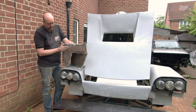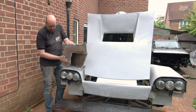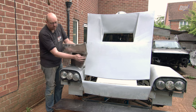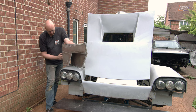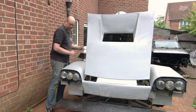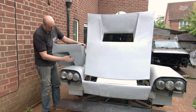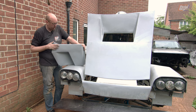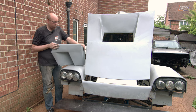After some work with the hammer and dolly on the front, I've managed to bow this out uniformly all the way across. There's still more work to do — I need to decide whether this goes out or in based on what the other one did. There's a small dent here that needs to come out and a little bit that just needs to push out. But otherwise all of the metalwork is nicely attached and cleaned down. I have another one of these that has had all the smoothing work done, nicely bonded over — it's probably about 90% there, with just a couple of little low spots needing a bit more filler to smooth it all out. This one is looking really, really good.